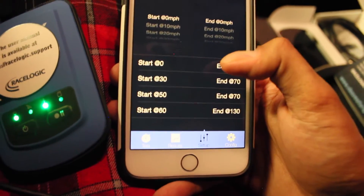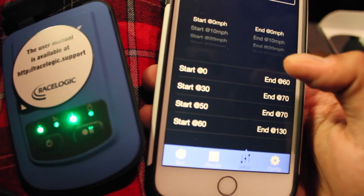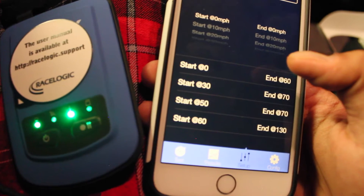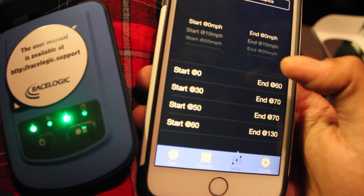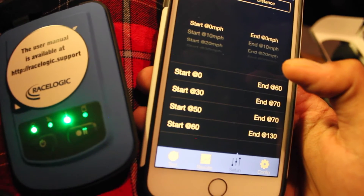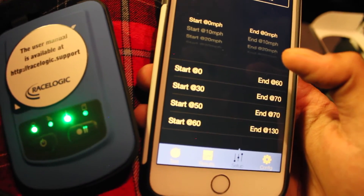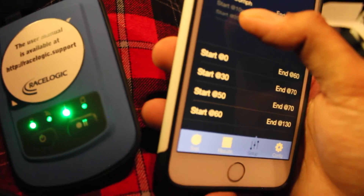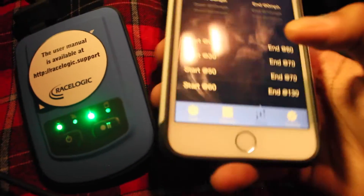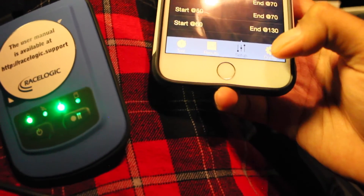I'm probably looking at zero-to-60 runs, but what I'm really looking for is a way to make a run without having to shift — so probably just leave it in third gear, start at around 3500 RPM, and go from whatever speed to redline. That way I can compare different mods and it'll be kind of like a dyno pull, because if I'm shifting then I'm adding a variable. You can still get accurate data doing that, you just have to do far more runs in order to make sure you're not changing anything between runs.